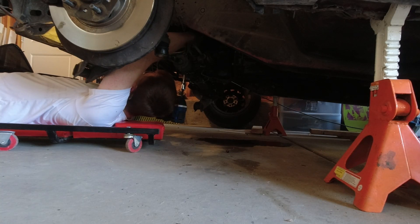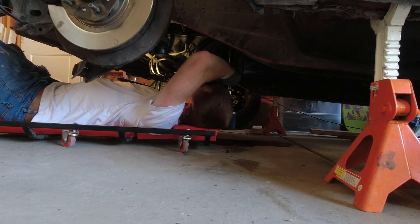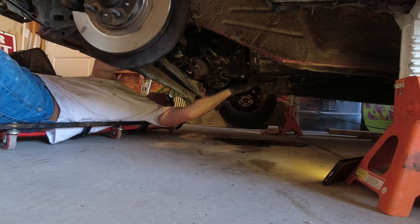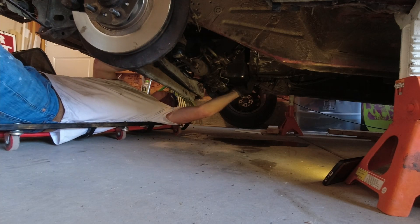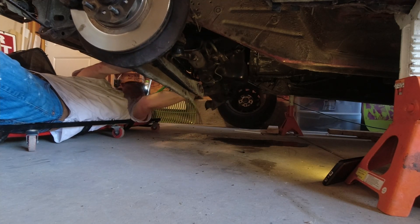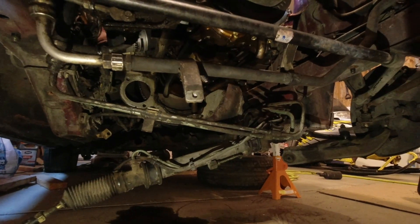Now I'm going to go underneath the car to undo the oil pan. The oil pan is pretty straightforward — there's just a bunch of bolts that go right around the edge and you just take those off. I did have to get a screwdriver and kind of pry on the oil pan just a little bit, but it came loose. After it taking longer than I expected, I got the oil pan off — I had to do a lot of wiggling.